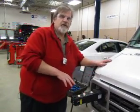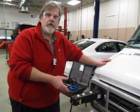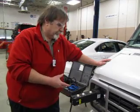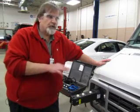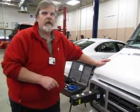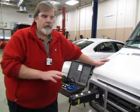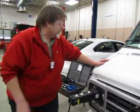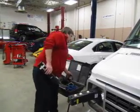These are not designed to stay there for a long period of time, but they will stay on for a few minutes while you're doing the headlamp aiming and checking the aim. Now, if you had a floor level setting, you would also set the floor level setting into your floor level dial. We're going to use a 0 floor level setting here today for this particular area, because this area is at a 0 level.